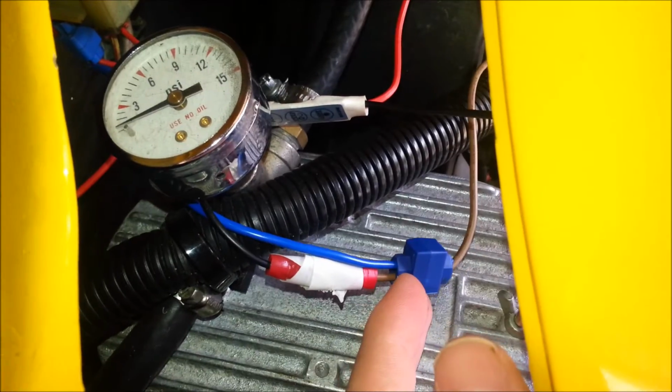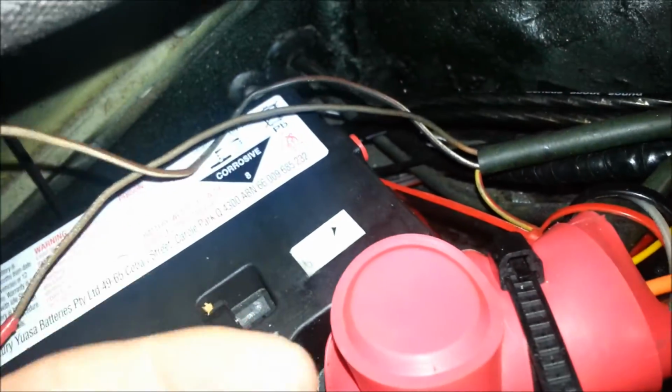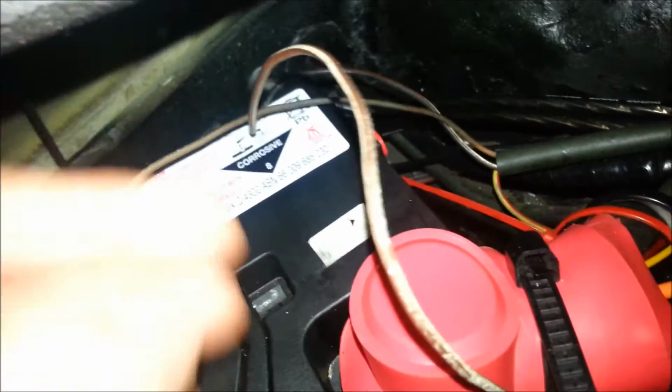So, what I did here was I connected a Scotch lock into that wire I have running around. And then that wire I connected into the test plug using another Scotch lock. Using another Scotch lock I connected into the test plug there into a brown and white wire which runs down underneath the seat. Now that brown and white wire isn't needed, it's part of the test system which is no longer used. You could just cut it out of the test block and do it that way, but I like having it looking like it's there, so that's why I did it with Scotch locks.